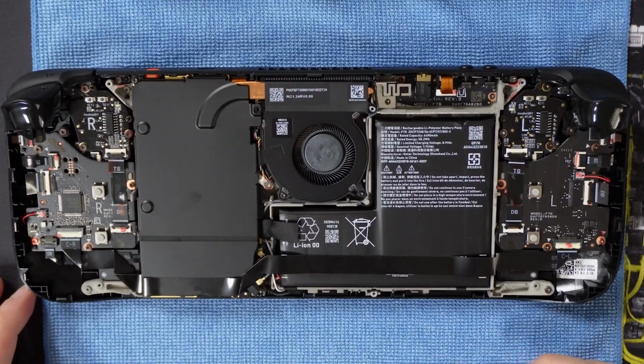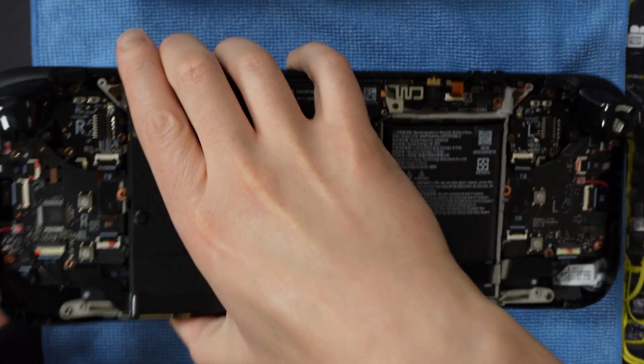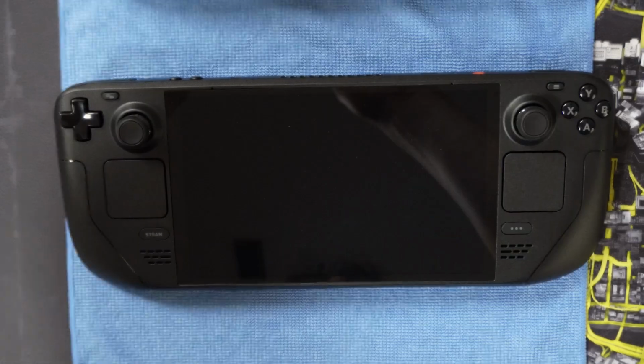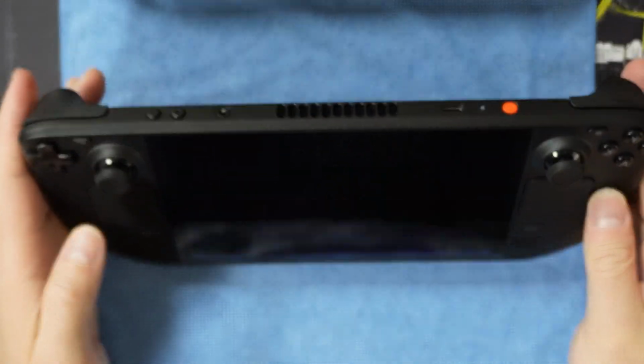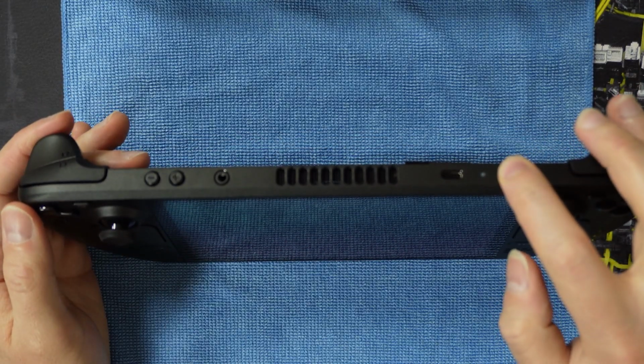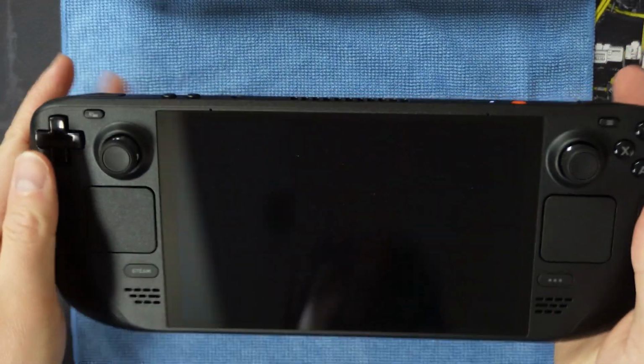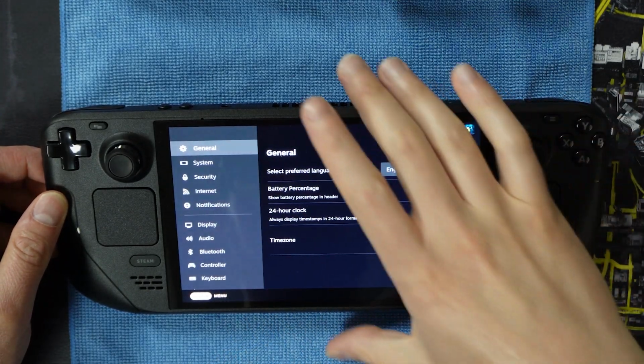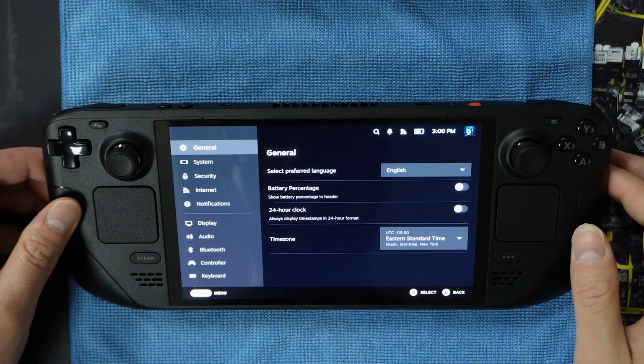Next is part 3. Rotate the Steam Deck OLED with the backplate still unfastened and detached, and prepare for joystick calibration. Press the power button to either power on the device or initiate the quick resume function if it was left on already during the previous parts of the guide, because you may have done that. Press the Steam button located above the left front-facing speaker or below the left trackpad. You know where it is.